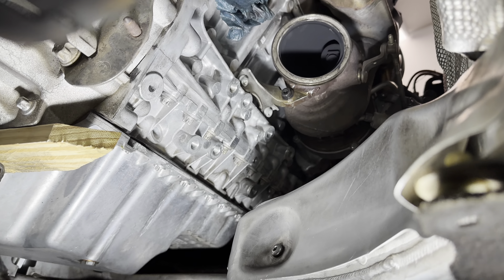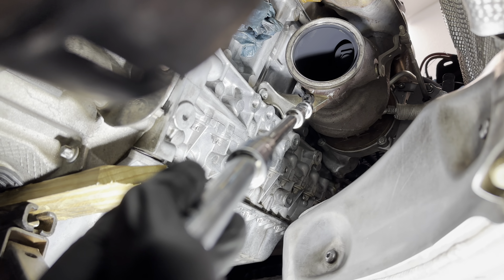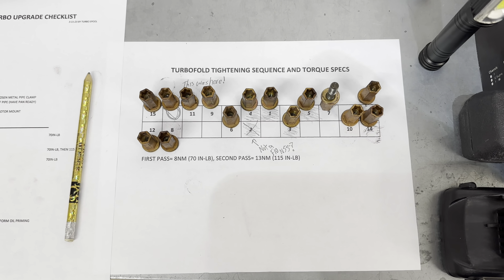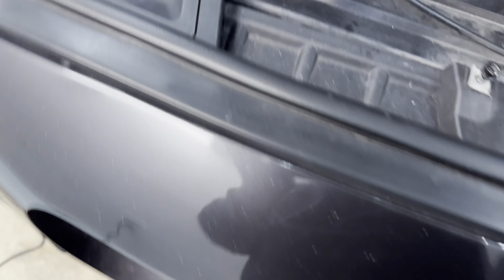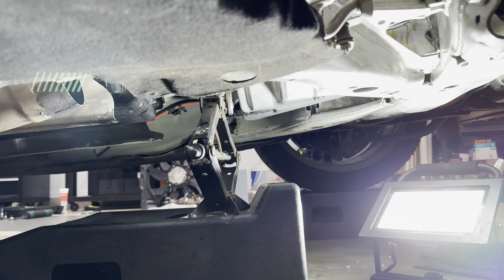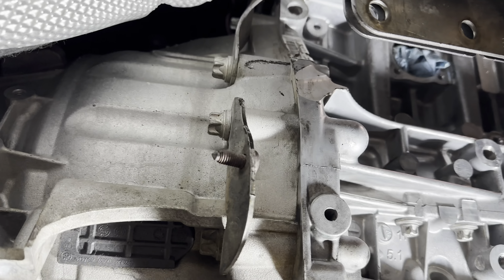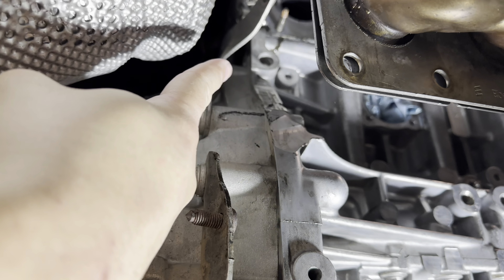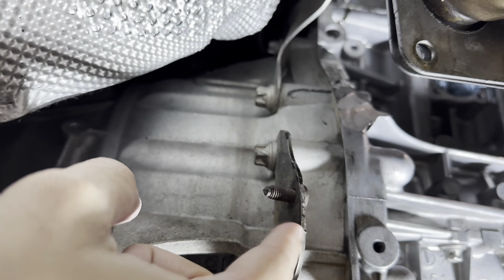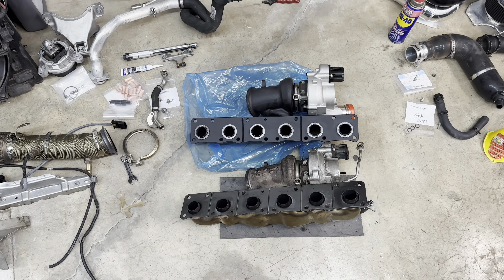The next step is to remove the support bracket for the turbo — these two bolts here and then this one against the turbo. All the securing nuts are off. The turbo is off the engine — I still got to get it out of the car. I had to push the turbo back up into place because it's getting caught on the old brackets for the factory catalytic, which I don't have. This bracket is catching it. I went ahead and took off the bell housing bolts that secure the brackets, put the bolts back in. It fought me every step of the way, but it's finally out.